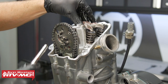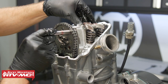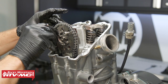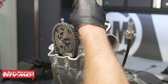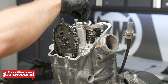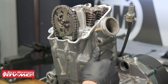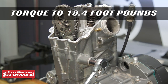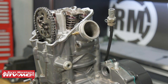One note about these rocker arms: we have this little flat machined surface on top of the pin that goes through them — make sure that is facing up. Next we can install our tensioner. We're going to torque the cap to 18.4 foot-pounds — we've got our new crush washer on there. Now we can remove this cap and use a screwdriver to press in on the tensioner until it releases and tensions the chain.